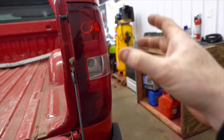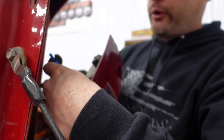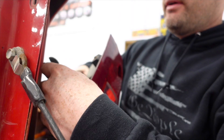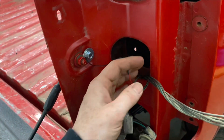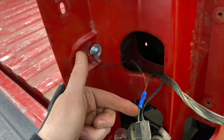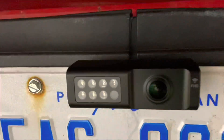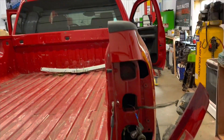I'm going to remove the tail light. I went ahead and removed my reverse light bulb, found the green wire, and slid the connector on, crimped it down, then hooked up the existing wire to the other side. To make this simple, I basically fed the wire right through the bumper, crimped all the wires together to the green wire, and self-tapped it right there with a washer for the ground. We are good to go — I'll put the light back on and back it out of the garage.